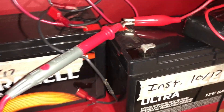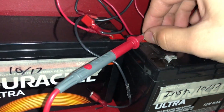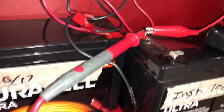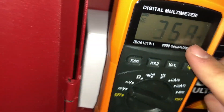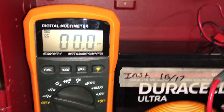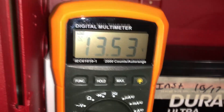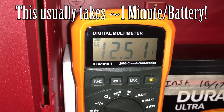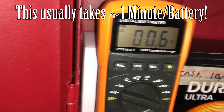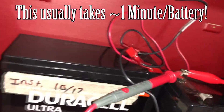Normally in the field I don't do this for time's sake, but for video purposes with only one hand, I have this hooked up like this. When I put the lead on the negative side it'll complete the circuit with the resistance and start going. We'll set our meter to DC volts — it should read millivolts or near nothing. Now let me attach it — it should shoot up to about 13. There you go. We're going to watch it count down. When it slows down it'll bounce back up — there, 12.52 again. So that's how we know this battery is good.